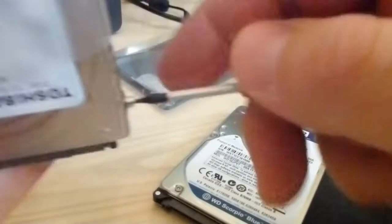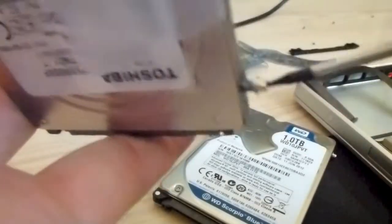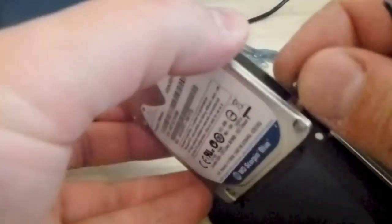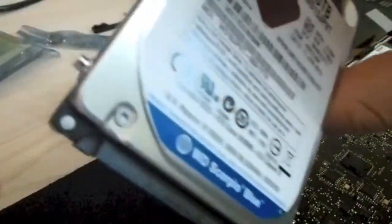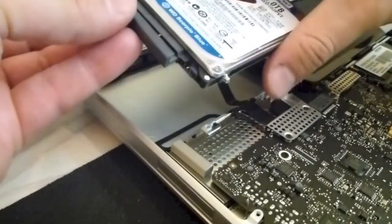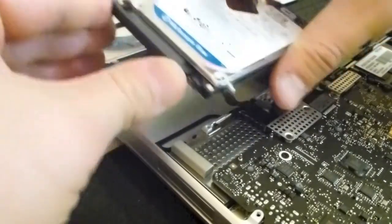If you don't do that, it'll wobble around and it's not good — it may break. A 101 mistake: never touch the bottom of the drive like I just did. Try and stay away from it because of static in your body — you could damage the circuitry and electronics. So we're back — I've screwed them all into the new drive. Now just take the connector, pop that in, align it with the notch, and it should go in fairly easily.